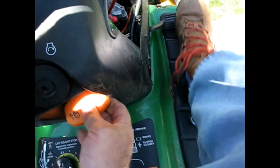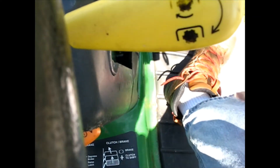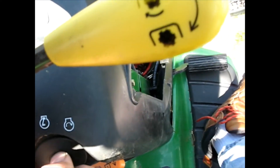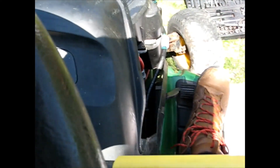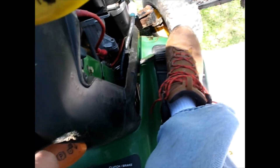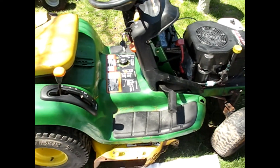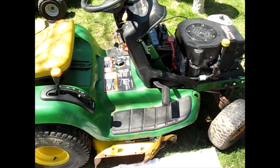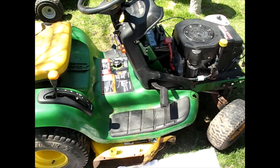Parking brake on. Does it start in that position? It should be a wide enough swath of pedal travel that it does — and it does with my foot. It works all the way down. It works a little bit up too. So, reliability issue solved on the LT-133, and probably a lot of others from the LT-Series likely have a similar pedal setup. Thanks for watching, please subscribe.